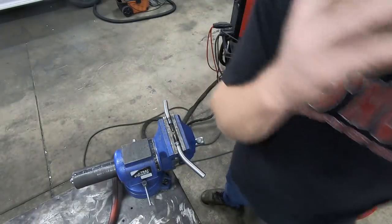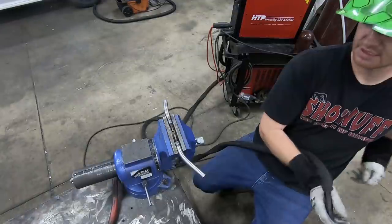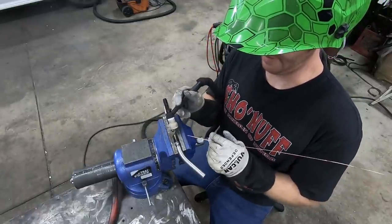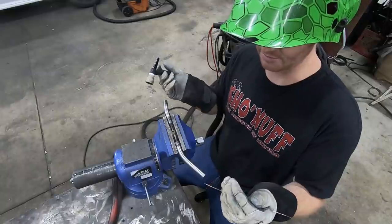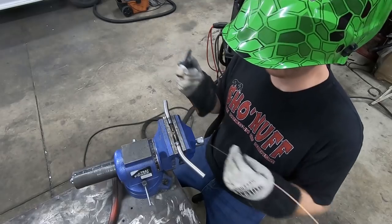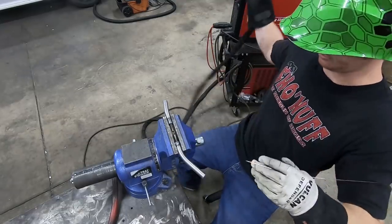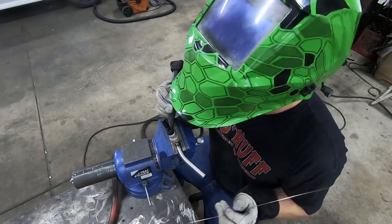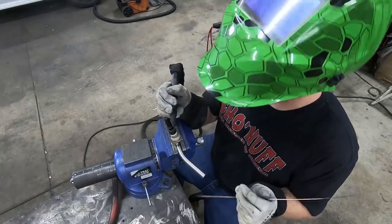Next I just need to hit it with weld and we'll consider these studded. I opted for studs versus nuts on the end because in the event of a nut rattling off, the stud will still be there to hold the radiator up - it would just have forward-to-back movement. As long as the front bumper is there it shouldn't come far enough forward to come off the studs. That's why I opted for studs as opposed to a bolt, where a bolt rattles out and the radiator could just drop straight down.